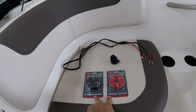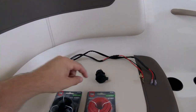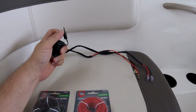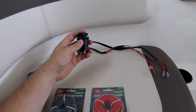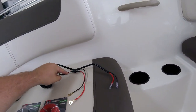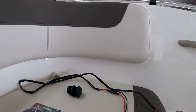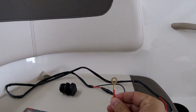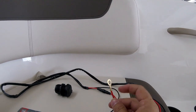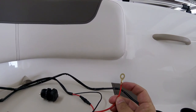I'm pretty good at wiring. I'll show you the wiring and the light switch install. I have bought 14-gauge wire — 20 feet of negative and positive. Then, off eBay, I purchased a 12-volt flush mount socket. For less than $10, it came with a couple feet of wiring and an inline fuse, which you always need when you're running something like this. I'm going to cut these off because the connectors are a little small for my battery terminal, but I have bigger ones — I'll cut these off, put new ones on, and use heat shrink to clean up whatever's exposed.